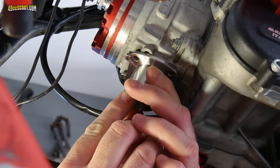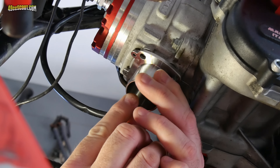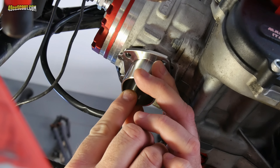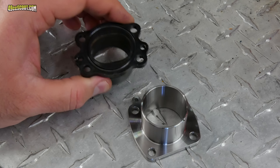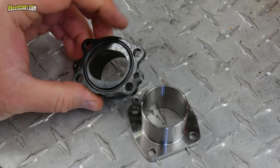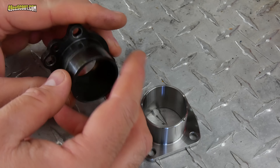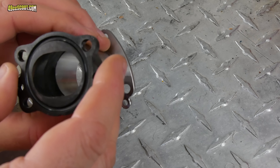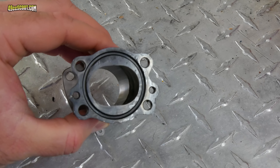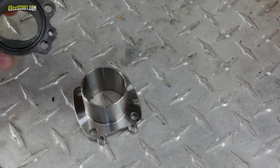The bolt pattern on the Stage 6 flange is different from the Molossi cylinder's outlet. Luckily, it can be rotated and used with just two bolts, and the alignment with the port is okay. It would be nice to use all four bolts, but most kits that aren't high-end only have two-bolt flanges. The Stage 6 flange has a round entry to match its corresponding cylinder's round port exit, while the Molossi flange transitions from an oval port match shape to round where it meets the header. I would prefer to have the port match and the transition of the Molossi flange, but the Molossi flange is larger than the Stage 6 header. I considered getting another Molossi flange and seeing if I could machine it down, but when I saw that it would probably cost over $100 by the time the flange is shipped, I just gave up on that idea.